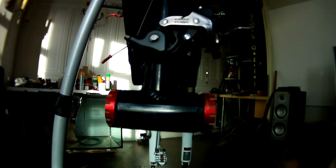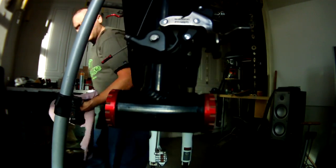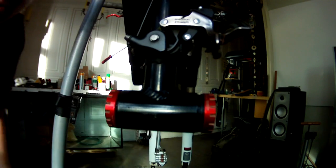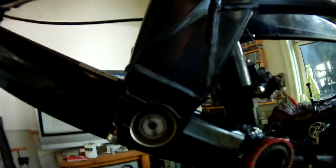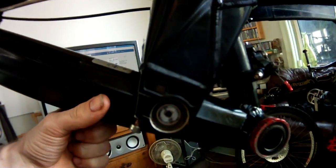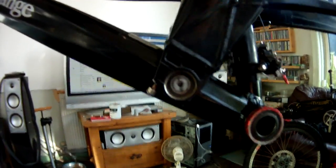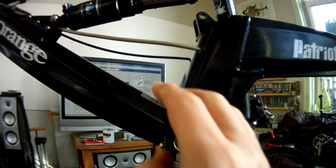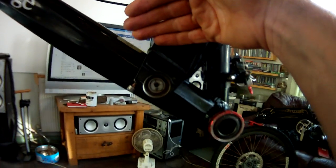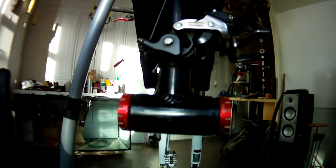Right, now get the nylon hammer and the rag on the opposite side, because the opposite side now looks like that. You see it's now deep in the socket. That bearing is now locked in position with this swing arm over this side, so you can hit it from this side now that it's down in the socket, and it will pop the opposing bearing off. So we'll do that now.